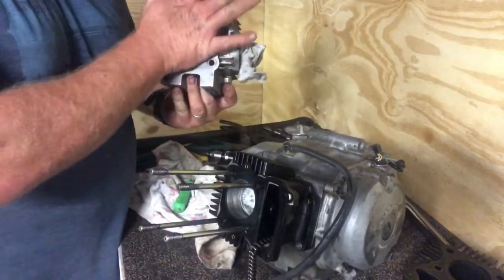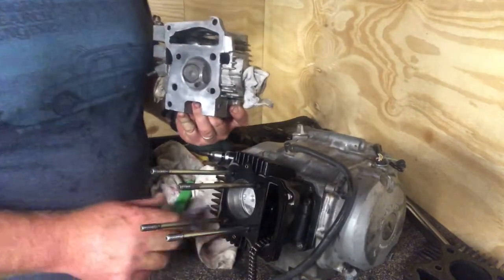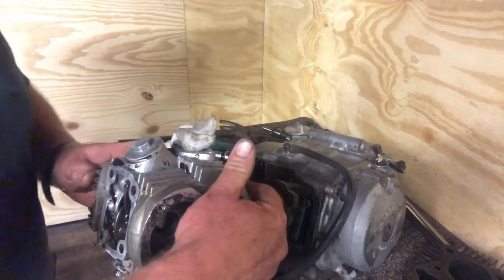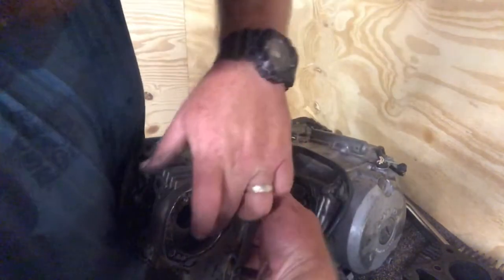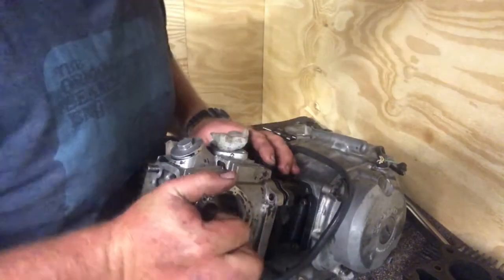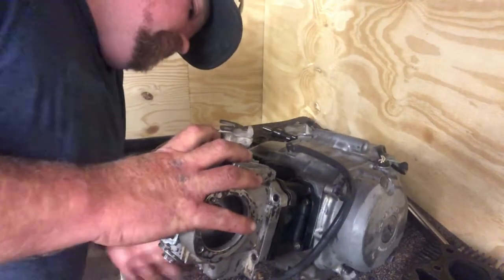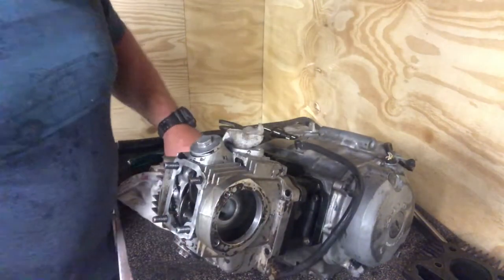What I'll do is throw the head on. I've got the gasket on — it can only really go one way. I put that on first and make sure it sits down over the dowels so we can get it on. Now I'm just going to put the head on. I'm going to grab that cam chain — it's been a bit of a pain hanging around, but we'll remove and deal with that in the next one.